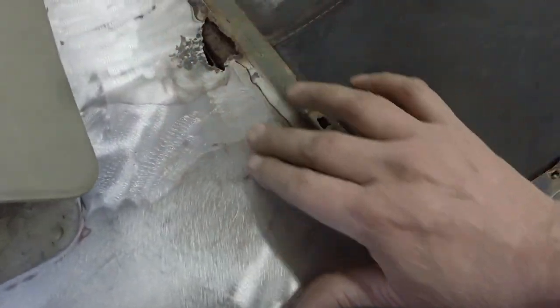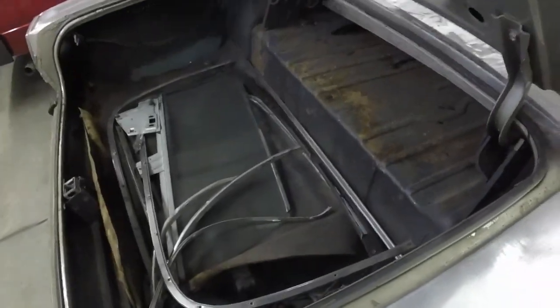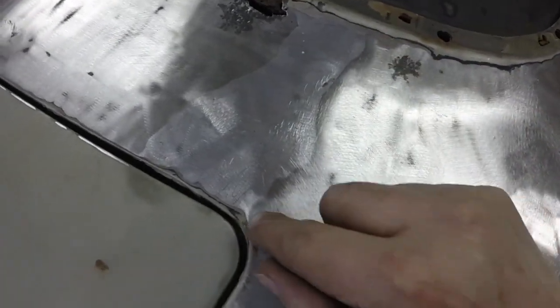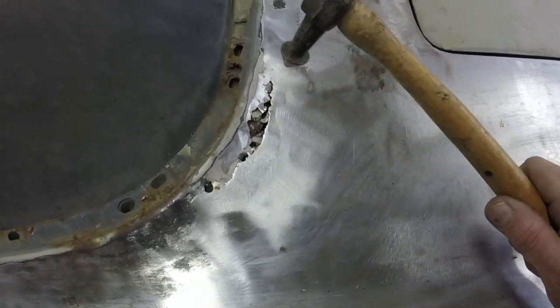And the same here. Tomorrow I think the top, and that's rusted through there. That's just this part underneath there, but that's a hole about the size of my finger. So I'll probably have to replace this from here to here, so this lead will have to come out. And the lead is cracked. I already got stuff in the trunk. The lead had a little hairline crack in it. I don't see it now, but take my word for it, I saw a little crack in the lead, and that'll just telegraph through, so I got to clean that out where it's cracked and take care of that. And then I took my body hammer where I'd been hitting where that body filler was, and it went through there.